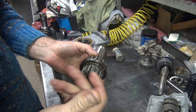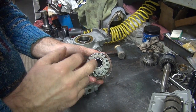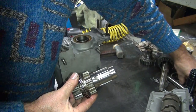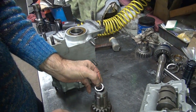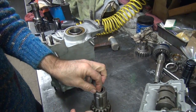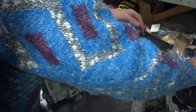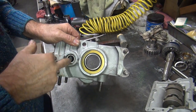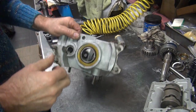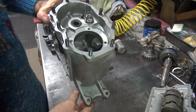So we have to melt it out, wipe it out, and obviously get these bearings out of here. And I should be able to put the snap rings and the little thrust washers in there, these ones here that are supposed to be in there. And we put our loose needle bearings in like we're supposed to. And get a new shaft, because that shaft is junk. My guess is these might not be the right ones, but we'll have to see if these are the right bushings. They might be the correct one, and it doesn't look like they're chewed up, so they might be usable.